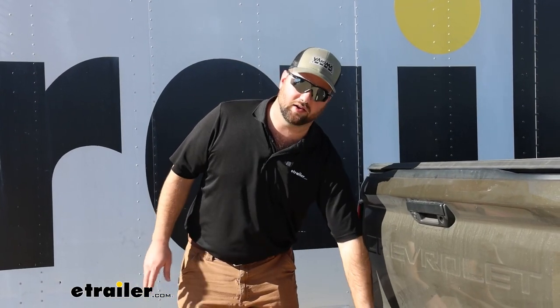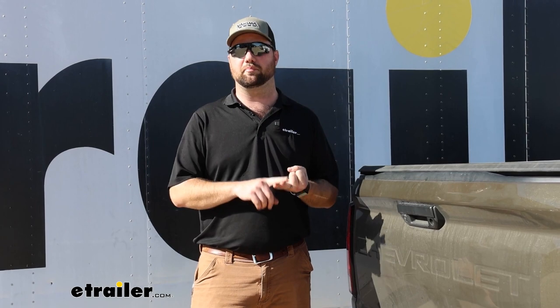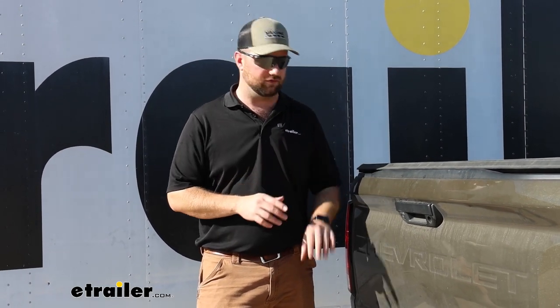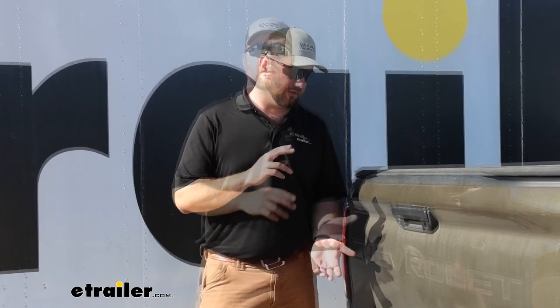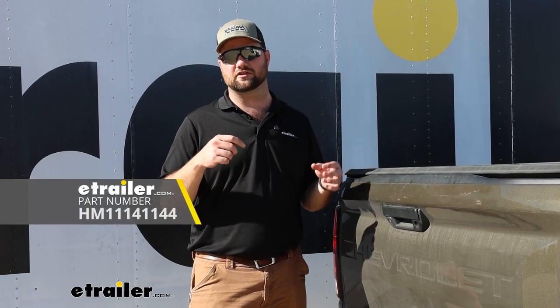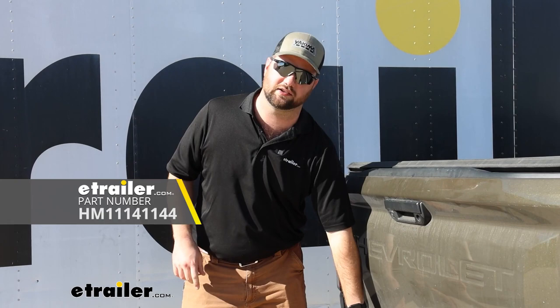Now, if you don't have the opening in your bumper like we do, there's going to be one of two things waiting for you behind the bumper. It's either going to be a bundle of wires or it's going to be the blank US car connector with a cap on it that's just tied up to the back of the vehicle. If you have the US car connector, I would highly recommend using the template that comes with the kit. You can take the bracket, put it up to your plastic, trace it out, and then your plastic will be perfect to just pop right through, and then you can put this plug into place. If you have just the wires, then we also have a kit that you can essentially wire up your own US car connector to connect in the back of this.